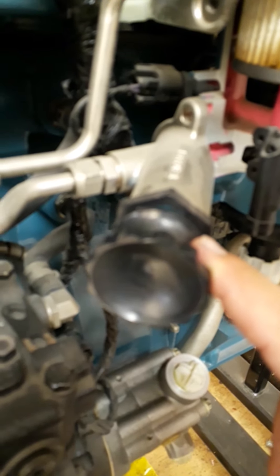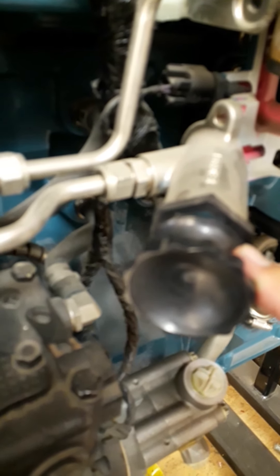Fuel comes in to the bottom section of the fuel filter — it's kind of a pass-through with a sediment bowl in the bottom. We still have a water drain and water-in-fuel light in here. There's a hand pump to prime it, so if we change the filter or the vehicle runs out of fuel, we have a hand primer that you twist loose — it's a plunger pump pulling fuel out when you need to prime it.